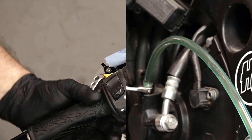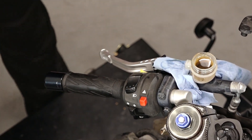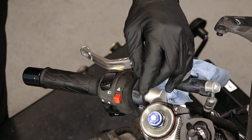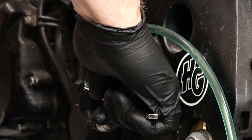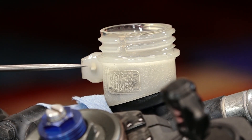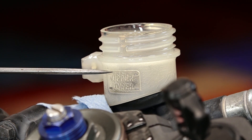How many times are you going to have to refill the reservoir? It's a little bit of a guess on my part, but I'm figuring at least ten — plus you'll be able to tell by the fluid getting pumped out, it's going to be a whole lot more clear than when we started. That's about ten times and the fluid's starting to look clearer coming out down at the slave cylinder. Now we want to set our level — we're going for this upper mark right here. That's your upper, and this of course is your lower. So I'm just going to fill it up to that level.